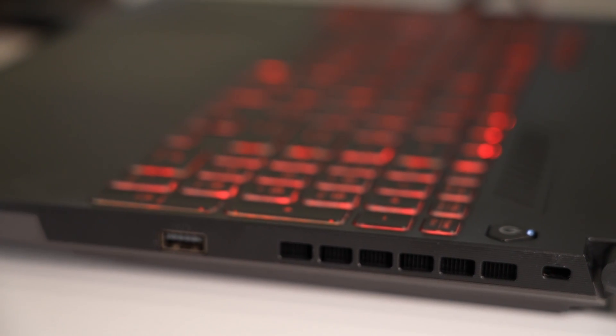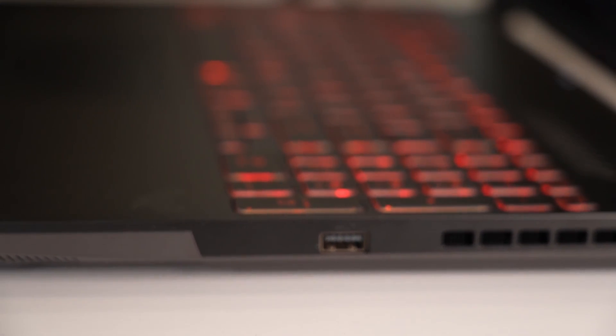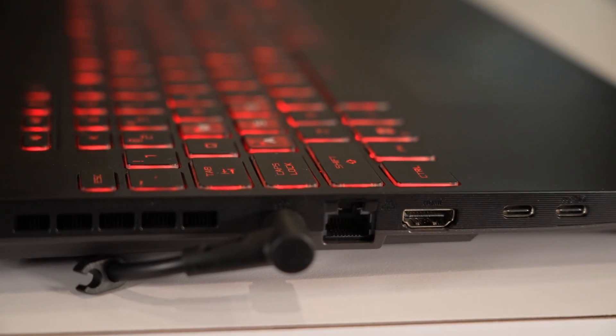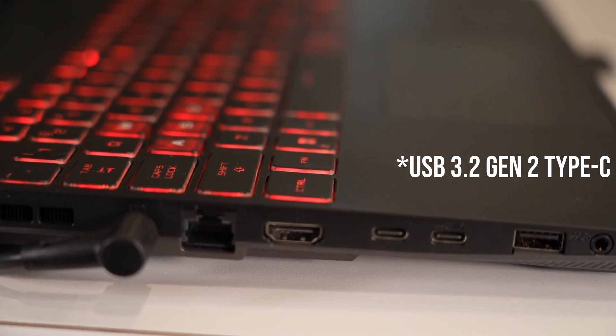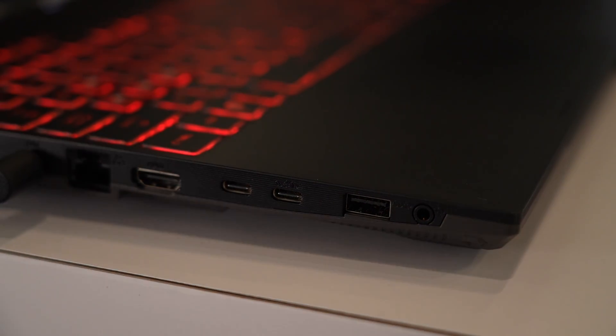The ports on this are moderate — not scarce, but not the ultra highest quality either, because this is a Ryzen-based platform. There is no Thunderbolt 4 support, which means no eGPU support. You can use 100-watt power delivery to charge the laptop or use USB-C power delivery docks. On the right side you have one USB-A 3.2. On the left side you have an Ethernet port, HDMI 2.1, one USB-C 4 port — which theoretically has the same throughput and feature spec as Thunderbolt 4 but just without the certification — one USB-C 3.2 with 100 watts of power delivery and DisplayPort support, one USB-A 3.2, and a headset combo port. I really wish there was another USB-A or USB-C here.